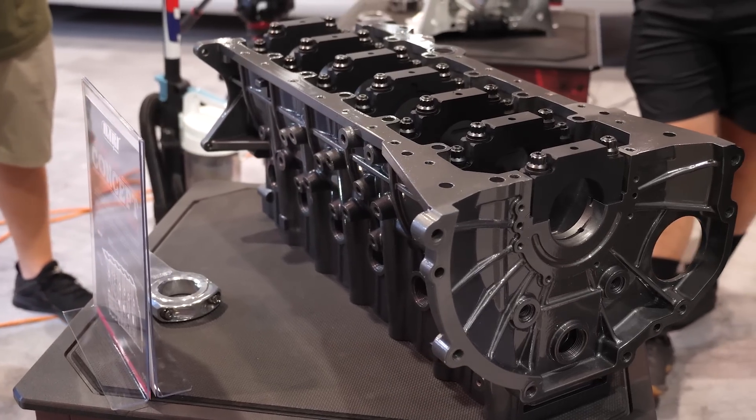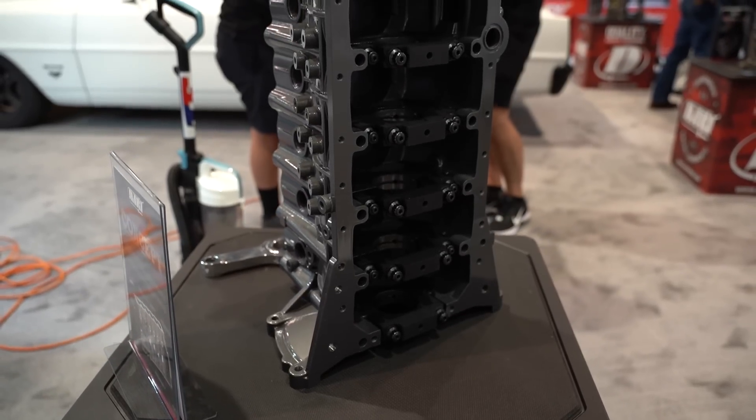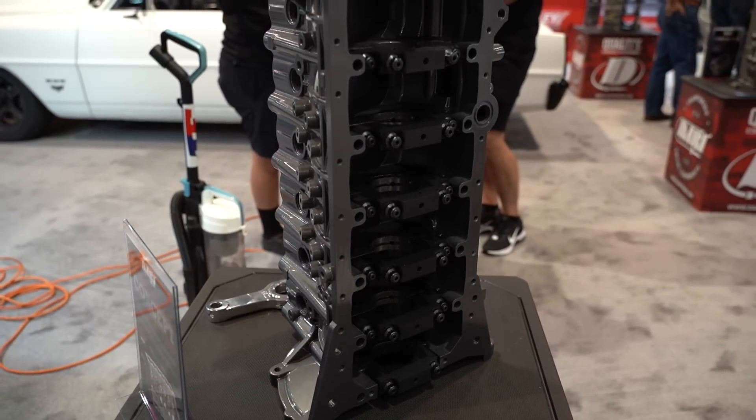In terms of accessories that bolt onto these engines, are all the external bolt patterns designed to take all factory bolt-on parts — engine mounts, external accessories? All the factory mounts are in the same location: water pump, oil pump, oil pan — anything that you would pull the engine out and service and change the block on, everything bolts right back up.